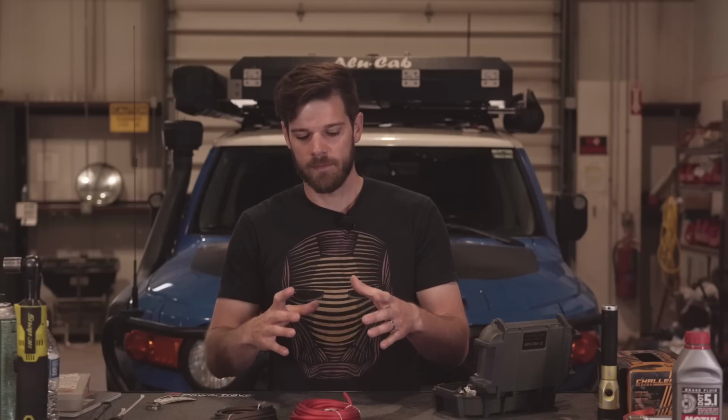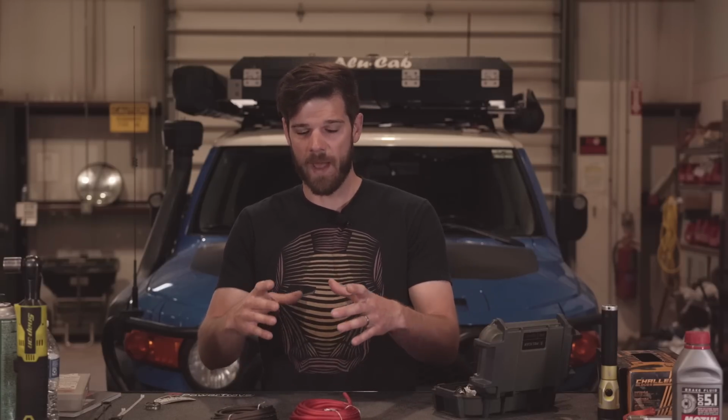So I was using my dual battery setup. I was going from one place to another, and I was combining the batteries to get a better charge on my auxiliary battery for about an hour or two, and it just isn't enough. With an AGM battery, if your solar is exposed to the sun for, let's say, 3 hours that day, and that's all it gets because you're sitting in between some trees or something, and you get a little bit of that sunlight coming through. In that 3 hours, lithium is going to take up to 5 times more of that power, so you can get away with less charging time and get more out of it.